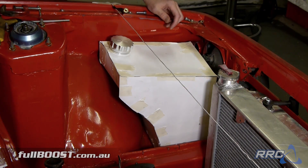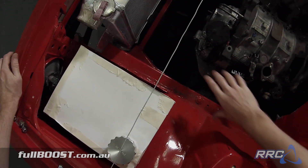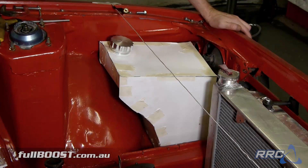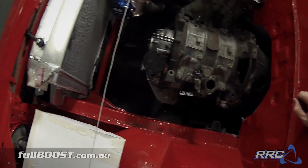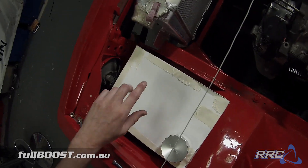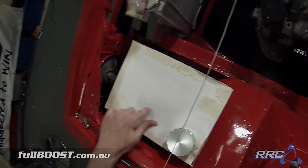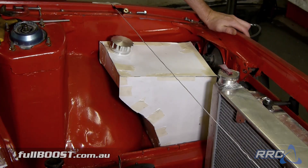For the fuel pump setup for this fuel cell, we're going to be doing something pretty differently. A lot of drag racing cars will generally run a mechanical fuel pump setup where a mechanical pump mounts here somewhere — it's gravity fed to the mechanical pump and the mechanical pump feeds the whole system. Very common in most methanol setups. We're running E85 so the fuel demands are not quite as great, especially with the power we expect to make with this car. What we're going to be doing is machining from that 12mm alloy plate that we used for the engine mounting plate, making a carrier to mount 340 litre per hour E85-safe ProFlow in-tank fuel pumps.